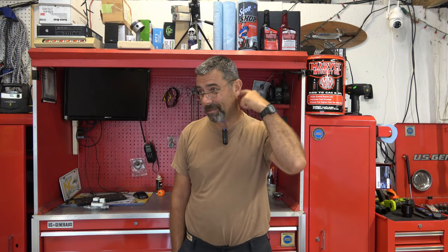The Volvo, which is not a great car to begin with, has suffered an electrical issue. I went off the mountain for a while, left the car parked, came back to it, and the battery is dead. Not unusual, you leave a Volvo sitting too long. There's a lot of key-off draw going on with those cars. But I get a jump box out, I fire the thing up, and what do we have? We have a problem. The fan won't turn off.